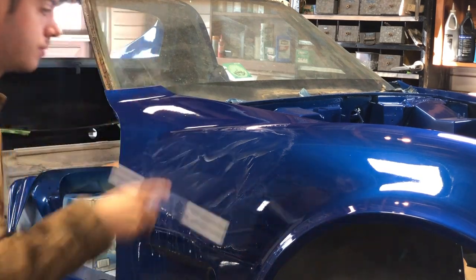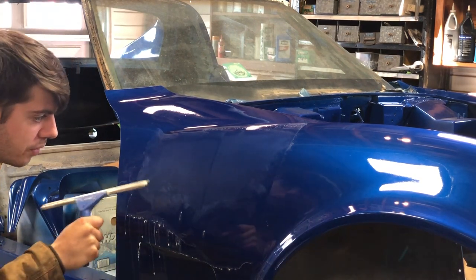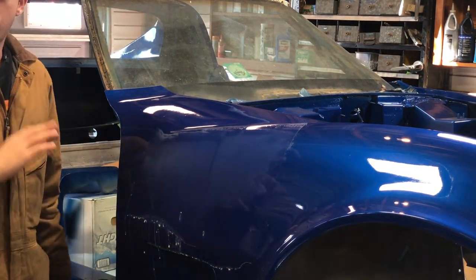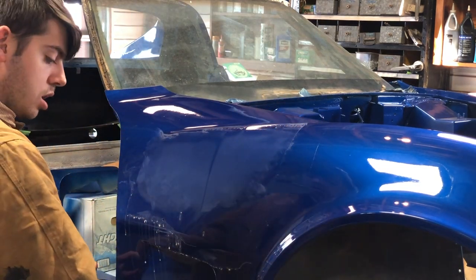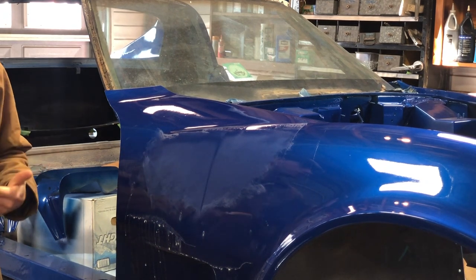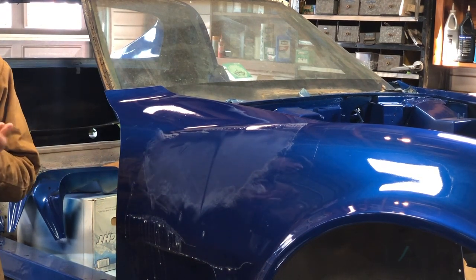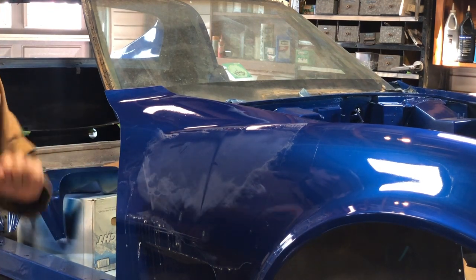I can still see a few areas I've got to work on, but for the most part that's just about done. Once you get it all dull at 1,500, you're done. 1,500 cuts more than you think it does. I'm going to finish this section with 1,500 and then come back to 2,500 and show you what you're looking for. 1,500 is much easier to start out with because it's very clear to tell when you're done. 2,500 takes a little more looking and understanding what's happening with the color of your water. I'm going to throw you on a time lapse and bust this out.